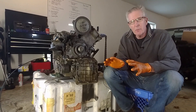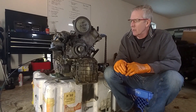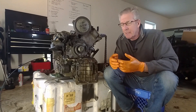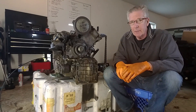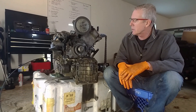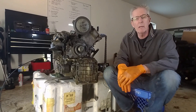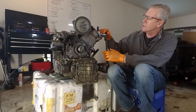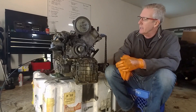There are two procedures for changing the timing chain. One is called the roll-in method, and that's the most popular and least expensive because you don't have to have the engine out of the car — just Google search that to find how that process works. But since the engine is already out, we're going full Monty on this one. That means we're going to change the timing chain and also the chain guides.